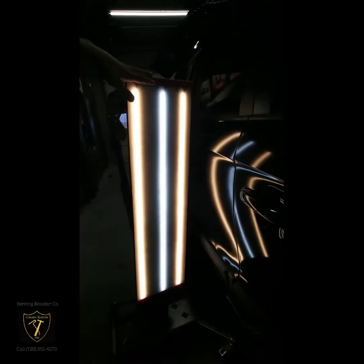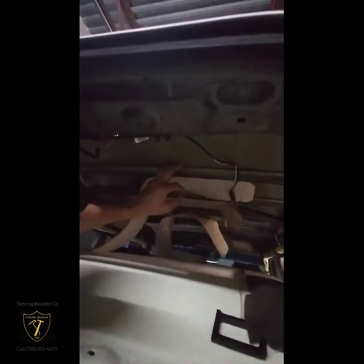And we also have our dent light, obviously, which allows us to see the reflection of the damage and the depth of it. So if we're in a situation where we're not actually able to get open access behind it, where we can get a big rod in, we have other tools that we use, such as this, which is called a whale tail. So it's like a limited access type tool. And so we would use that in a space such as on the roof of this vehicle if I had a dent right behind this brace here. How it works is the tool just goes up in, and then I twist it, and I'm able to make my pushes to bring that dent out. This was a hail vehicle, so everything's taken apart. I already did fix the roof though, so I can't actually show you that. There's nothing left to show you.